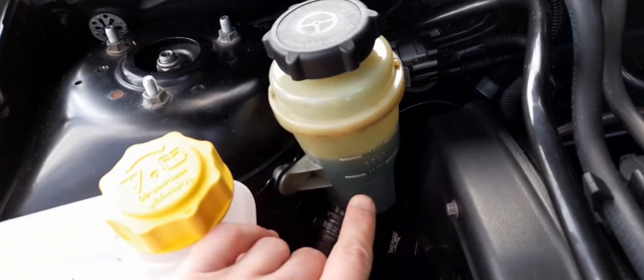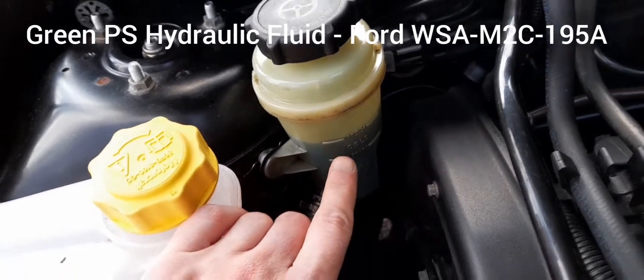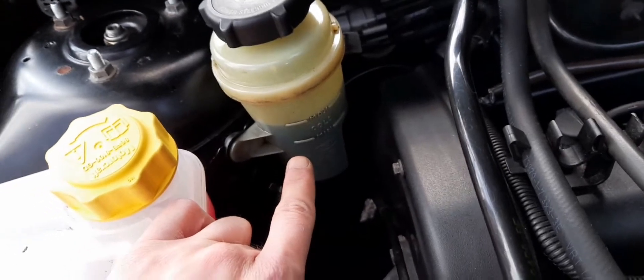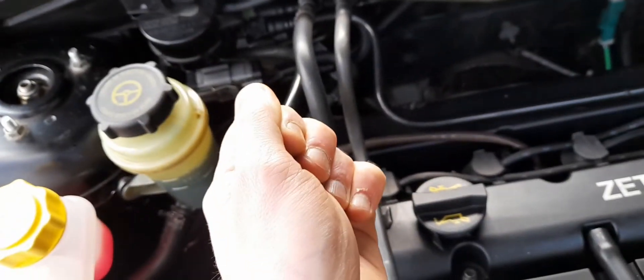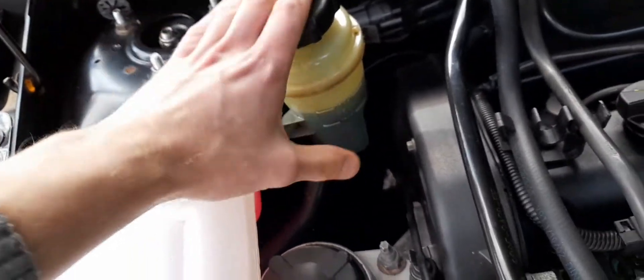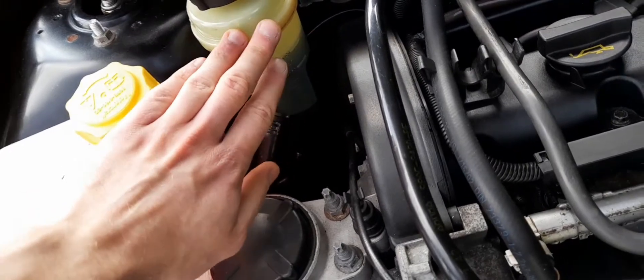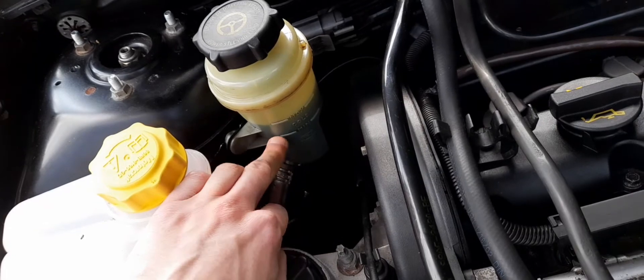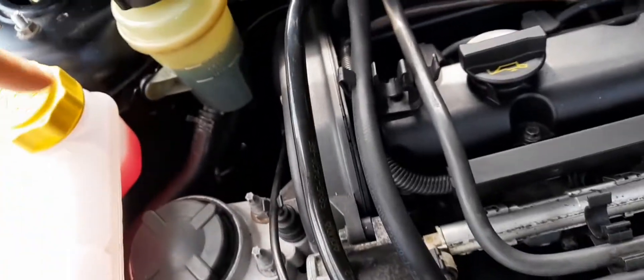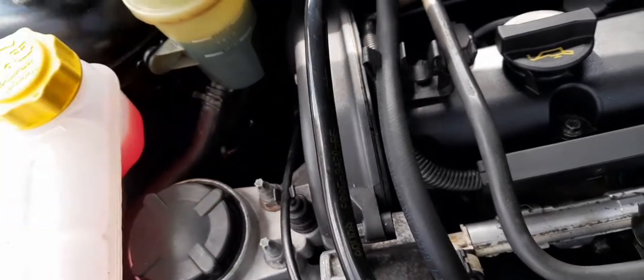Power steering - I'm going to put the correct fluid in the description because people get that wrong all the time. People put automatic transmission fluid in - that's okay to top up in an emergency, but you really need to use the green hydraulic fluid. A common problem is that the power steering racks tend to fail - when you go around a corner they go stiff and then clunk. That's the rack skipping a tooth because it's worn. Ford don't stipulate any requirement to change this fluid, but I think you need to do so every five years or so. Take the bottom hose out, put it in a bottle, top it up, get the front wheels off the ground, have an assistant turn the steering back and forth - the old fluid will drain into the bottle. Just keep topping it up. It's an easy procedure.